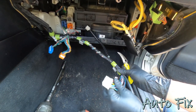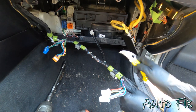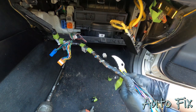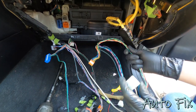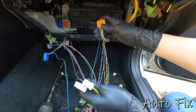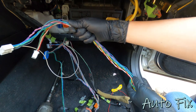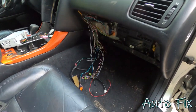Now we're going to start tearing apart this harness, because we need to get these wires - the connectors that were plugged into the amp - to reach up into the dash area. Use a knife very gently, just peeling back the factory tape without cutting the wires. You have to remove it so the wires can reach all the way into the dash where the head unit lives. Once separated, you can reroute all these plugs so the harness can reach.